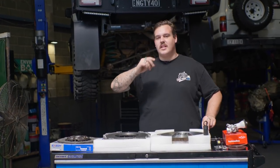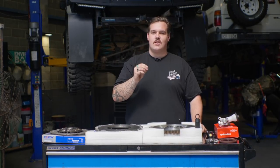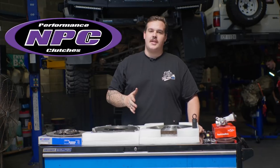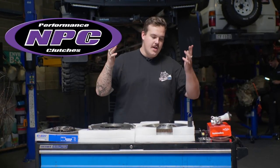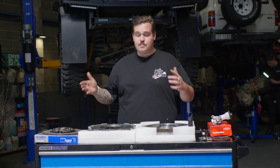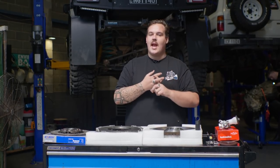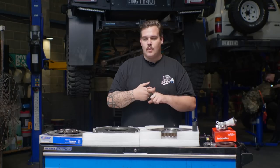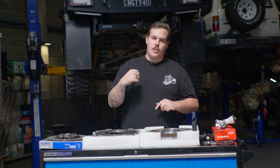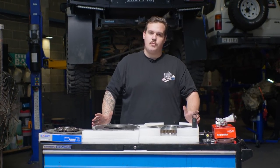So why are we here in the first place? Well, it's because we recently did a whole lot of power upgrades to the 80 series and the clutch we put in it about two years ago is just not putting up with what we're asking of it. As everyone will attest on the internet, MPC was basically the only option for a car with this sort of power. In front of me is the MPC 1300 newton metre clutch kit, specifically designed for people that are towing heavy loads, have got a heavy vehicle going caravanning, or have got a huge amount of power — and one of those is me. This thing saw over 800 newton metres at the rear wheels, which probably means maybe a thousand newton metres at the flywheel, so it was going to be pretty important that we had something spicy to put in the car.